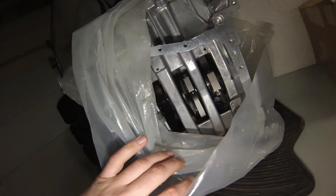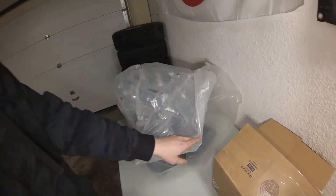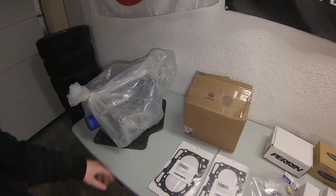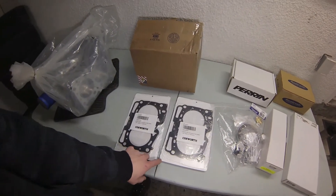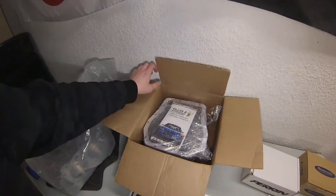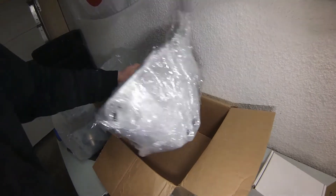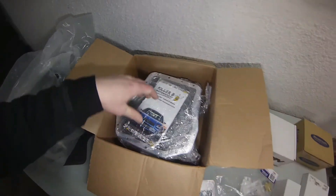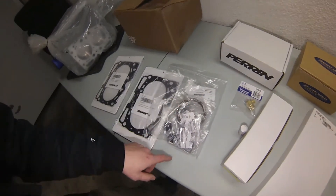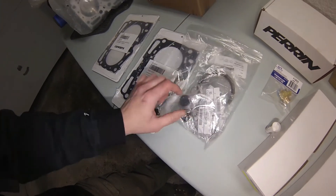It's got a razor edge on it — you can tell it's been machined right down. Just absolutely gorgeous block, built for making big power — something I'm absolutely privileged to be working on when you've got that kind of quality. With an expensive block you go for the top quality gaskets, so some Cosworth multi-layered steel 1.1mm STI head gaskets. We'll be putting on a Killer Bee oil pan — you can see quite a bit of extra room, it's got all the proper baffling inside and the extended pickup so that you don't run dry.